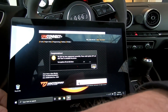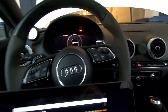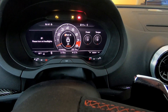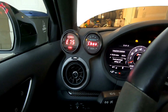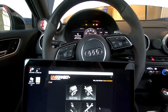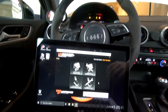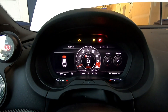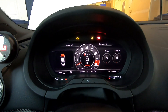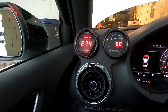You're done flashing your ECU. Now the next thing I need to do is fill up my car with gas. But what I wanted to show you guys first is the level of fuel that I have — currently I have two bars remaining, good for about 55 kilometers on ethanol. I currently sit at E75. What I'm going to do is fill up my entire tank with 94 octane with 0% ethanol and let it balance itself out by adding all that pump gas. I've filled up the tank all the way to the top — put in about 39 liters of fuel. But my ethanol gauge hasn't changed, simply because the fuel hasn't gone through the fuel system yet.